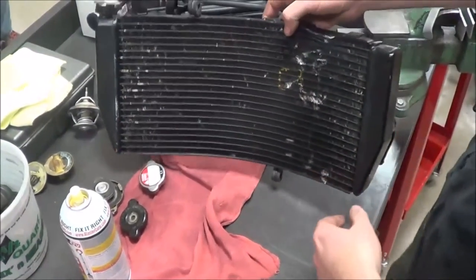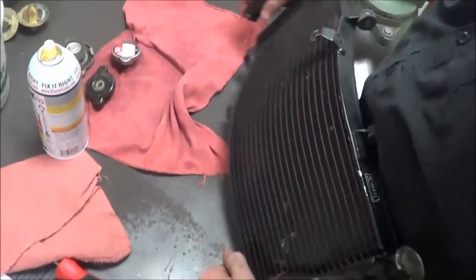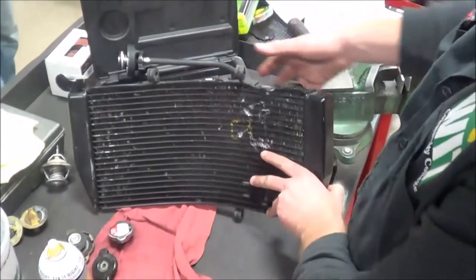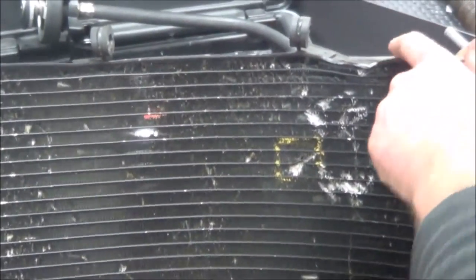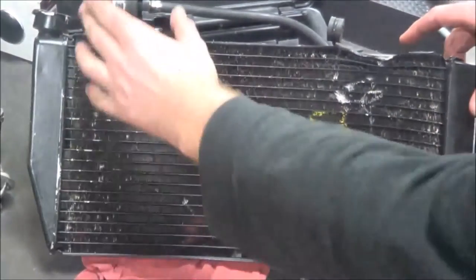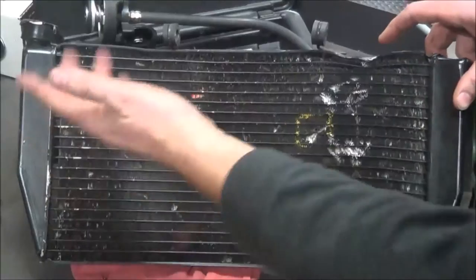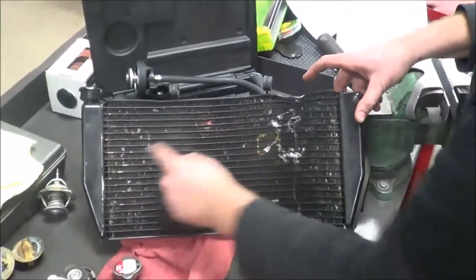You don't have to have the motorcycle installed to test the radiator. Just put a hose on both lines, plug the inlets and outlets with a large bolt or machined aluminum plug, then use your pressure tool. On this radiator you can see the fins are smashed down — but that does not automatically make the radiator bad. If coolant can still flow through, it's just reduced the overall cooling ability slightly. For a street bike, that small smashed area when you still have all the rest — I would not be afraid to use it.